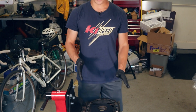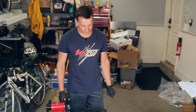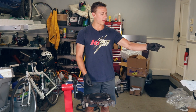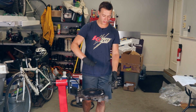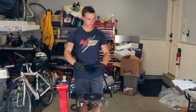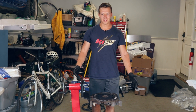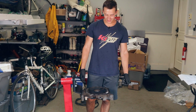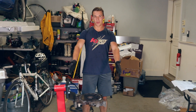I'm hoping that this will last for quite a while, but I guess that depends on how well we do this right now. Building a rotary engine is pretty simple. All it is is this front iron — we're going to put the front housing on, the front rotor, do the apex seals and a bunch of lube, the center plate, then the rear housing, the rear rotor, the rear plate, a bunch of lube, and I think that's all there is to it. Then we've got ourselves an engine that's hopefully built up and won't blow up again. So without further ado, let's build ourselves an engine.